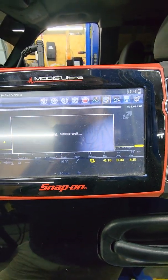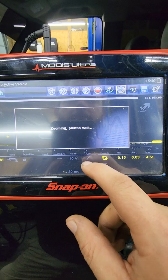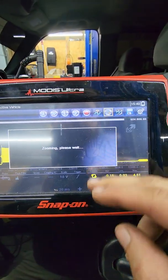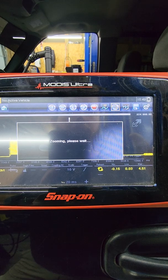Zoom to go back to the trigger point. By the way, the trigger point — you can have a wave going up or a wave going down, you can change what your trigger is. If you're going from zero volts and you're expecting a voltage spike, just set it to where the wave goes up, so it looks like right here.